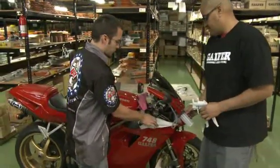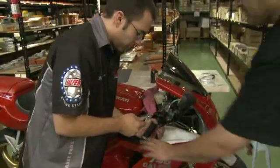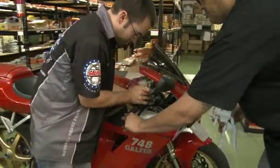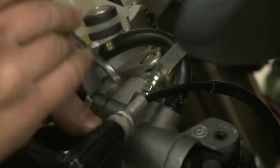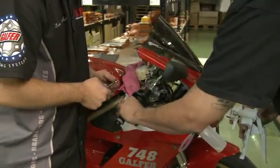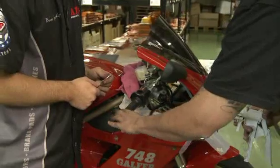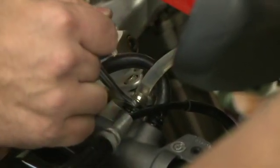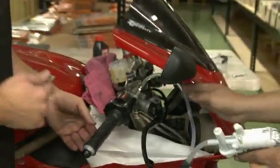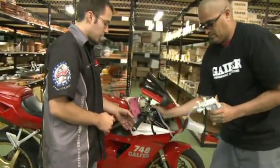We're going to pump the lever a few times, build up some pressure, then hold the lever down and crack the bleeder. You can see air bubbles coming out — once you have air bubbles coming out you want to close it back up. Before you let go of the lever, make sure it's tight. Then let go, pump it again — usually about 10 or 12 times. Hold the lever again, crack the bleeder, and you've got more air bubbles. Tighten it, let go, and pump again. You should start feeling pressure building up. Use the MightyVac to keep vacuum and suck the fluid out, then break it off the nipple.